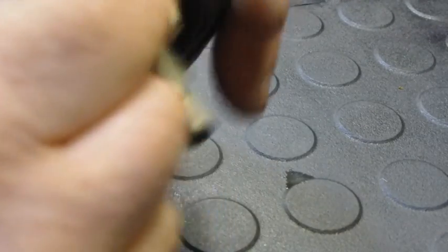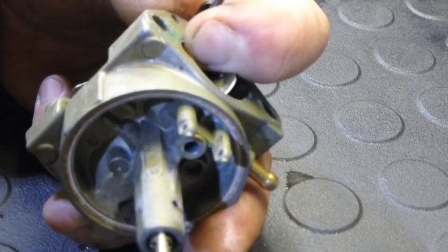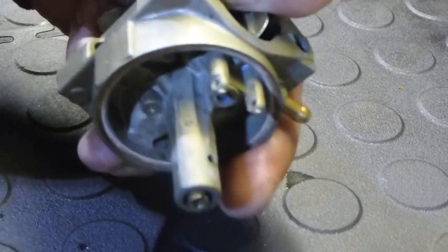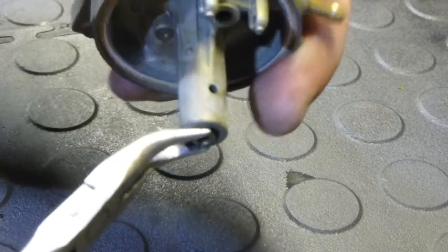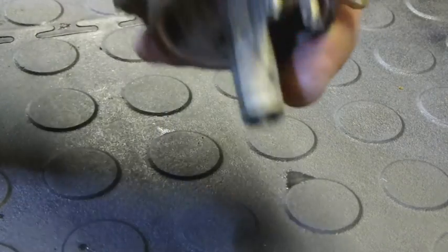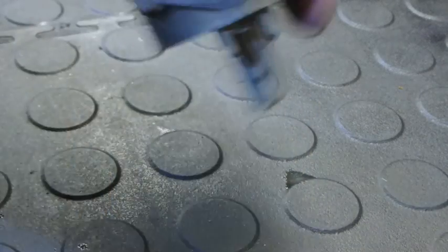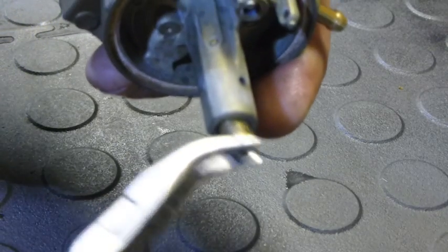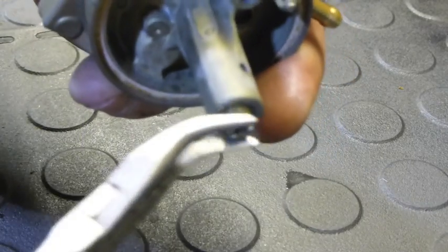Pushing down puts a little bit of pressure on the jet, and the jet has started to come out now — it's come down that bit. You can usually now just twiddle it a little bit, because it's still caught on the threads that hold the bowl. Sometimes they just fall out; other times, like this one, they need a bit of edging out. Push it down a little bit further. You can feel the drag of it on the threads getting it out. You can see it's a bit of an interference fit. So take it out.